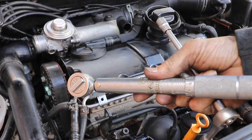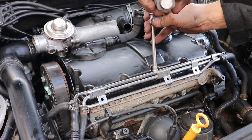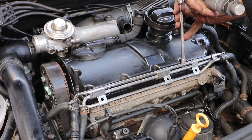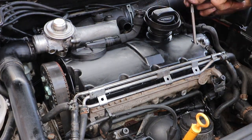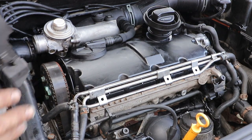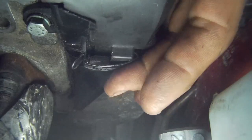Now that's all threaded on. Now I'll use the torque wrench to torque them up to the correct torque, which I'll leave in the description. Right, that's done nicely. Put the breather pipe back, clip it into place. Now the cam belt cover, which is a little bit fiddly, it won't clip on until it's seated correctly. Feel around the back for the clip. Nice.